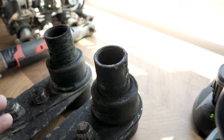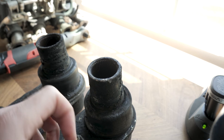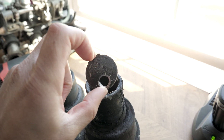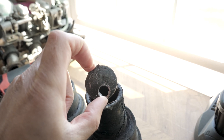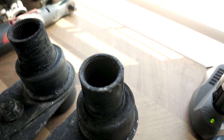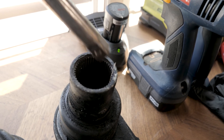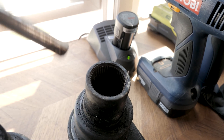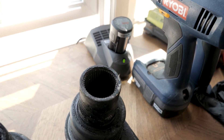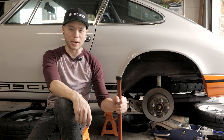Real quick while I've got these on the bench — I didn't do a very good job of explaining how you actually hammer the torsion bar out. Here is the spring plate, this is the little piece that comes out the side, and normally they've got a little cap on top right there. You drill out a hole that's kind of off to the side a little bit so you try to avoid damaging the torsion bar. Once you get that drilled, you wedge your screwdriver in there, pry the thing off, and that exposes the torsion bar to get hammered out. Spray your PB Blaster around there, put the flame all around, then using something like this extension, pop it up against the torsion bar and whack away with your big-ass hammer. I wouldn't wish that on anybody — definitely don't do that at home — but it's out.